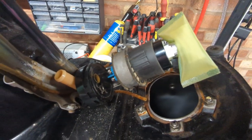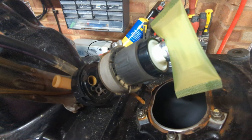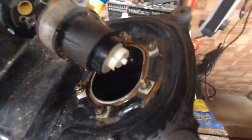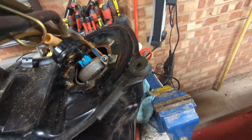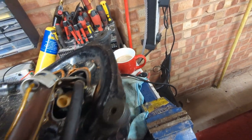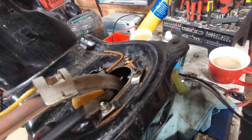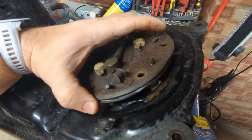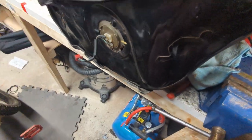And then I've got the pump with its own vibration isolation, coupled up with a piece of the original vibration isolation. And then there's the sock at the end here. We might have to use the sock that fits flat against the end of the pump. But I have test fitted this into the tank without the sock on it, and barring a bit of a jiggle to get it in, it fits. This hanger normally sits flat against the bottom of the tank with two rubbers anyway, and it still